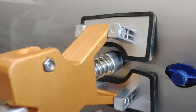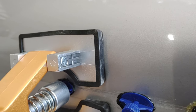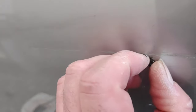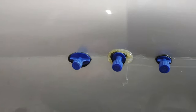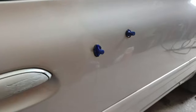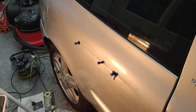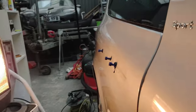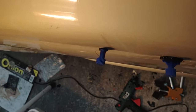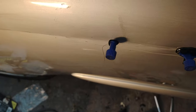I've used the black glue this time, which is even stronger. If you watch the metal now - there you go - it's pulled that out quite a lot actually. It's not so much of a groove. This just peels off, and it has pulled that out a little bit more. I've also put black glue onto those other ones, which will hopefully help pull those out as well. The dent is pretty much out now - it just needs to take out some tiny dents but it's pretty straight. You can only see a slight indent, so we'll just reduce the size of those pullers.